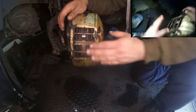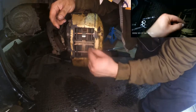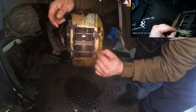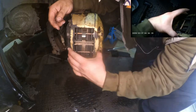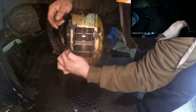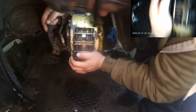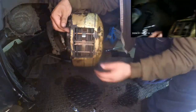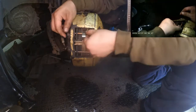The brake caliper is here, so the brake pads are here — you can see these two. You've got the sliding pins here; the sliding pins are in place, they're pushed into place, and then you've got the cotter pin in there. I've removed the cotter pins already from mine. What you need to do is just push out the sliding pins one at a time.